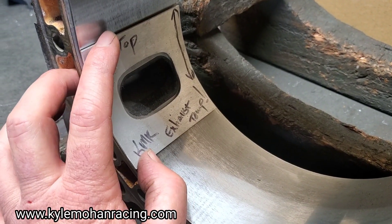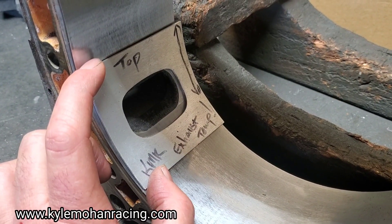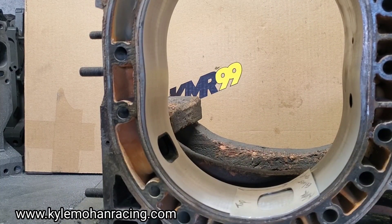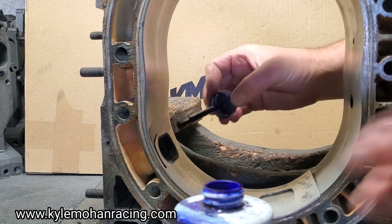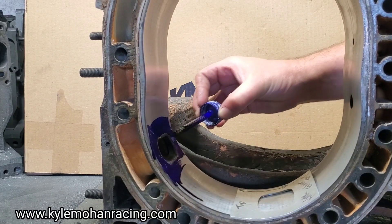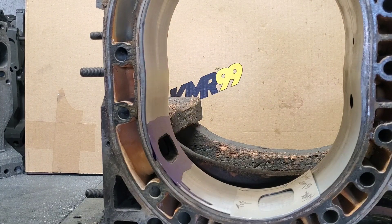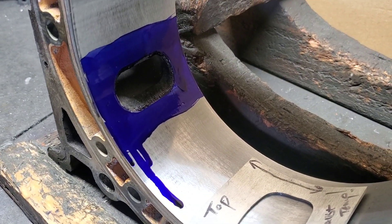The other great question I got was: how do I mark these and keep them consistent if it does not come pre-positioned? So we're going to cover that right now. I like to use Dykem blue to mark out metal for any type of scribe work. You just want to get a good coating down — the housing needs to be cleaned, acetoned, so the Dykem actually sticks. You'll clean that off later. And there you can see we've got some nice marking on it.